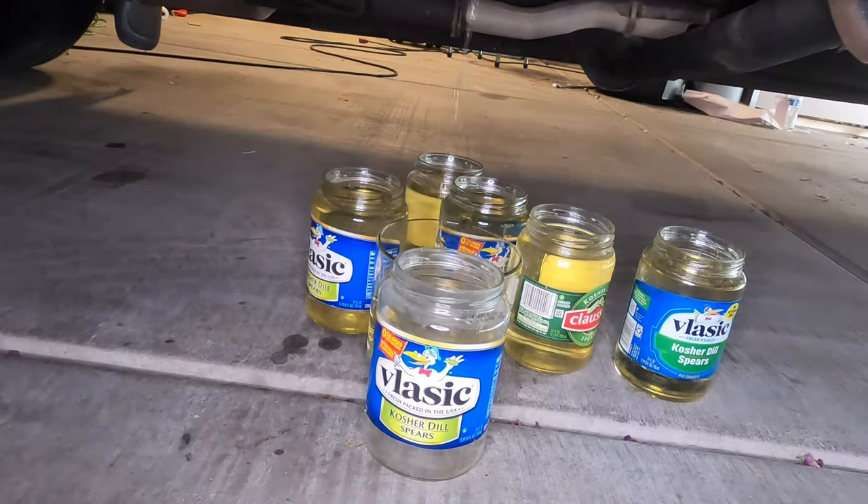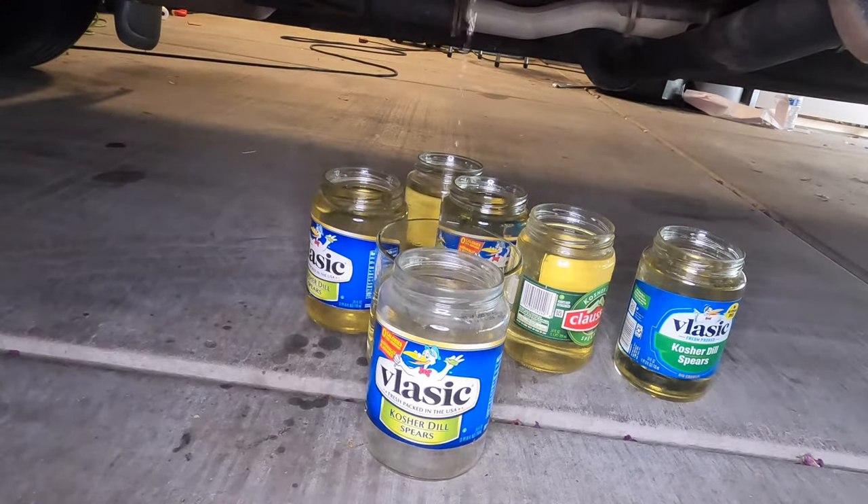Something that I forgot, and nobody ever really mentions in the videos, is I have a completely full tank of gas right now. Since the truck is up on its side and at a weird angle, it's leaking out of the return. I had to deal with this while making videos for all the other stuff, but go ahead and plug the fuel filter in so that it'll stop doing that.